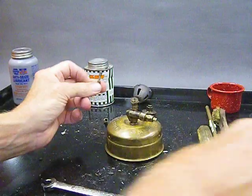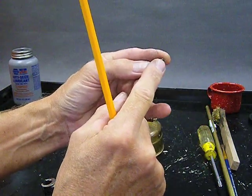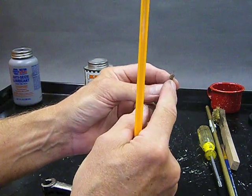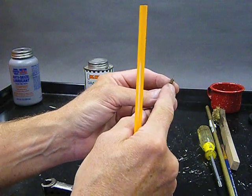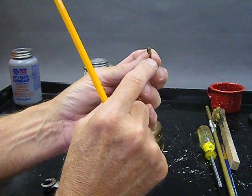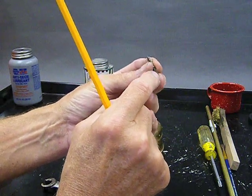Really seriously, next step. This is our cleaning needle. It's got those teeth on it. It's got a needle at the end that goes up through the jet. These are strictly kind of a gimmick for this stove. It's nice to have it, but before they did this, they had little slips of metal with a wire in it called a pricker, and you just manually prick it, and that worked fine too. If you like having more mechanical stuff in your stove, then put this back in. If you don't, and you leave it out and try to resell it, well, then you'll lose value. So I guess it's worth putting it back in.